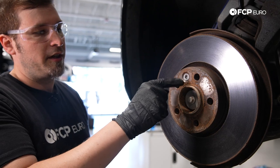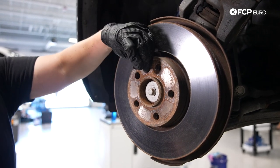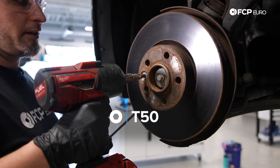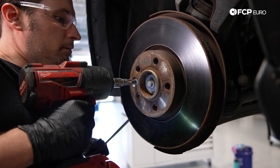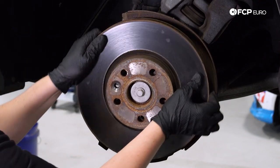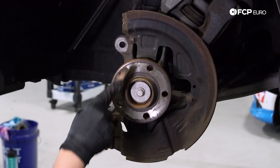Now we're going to remove the rotor, which involves taking off this set screw — it is a T50 Torx. I'm going to apply a little bit of impact to see if I can free it up, as this is going to be pretty rusted on there. Use a counter hold on the rotor so that it doesn't turn when you're using the impact, and make sure you have good pressure against the bit so you're not at risk of stripping it out. The rotor is going to be pretty well fixed to the hub even though there are no fasteners keeping it on, so you need a little bit of persuasion — I have a small metal hammer.